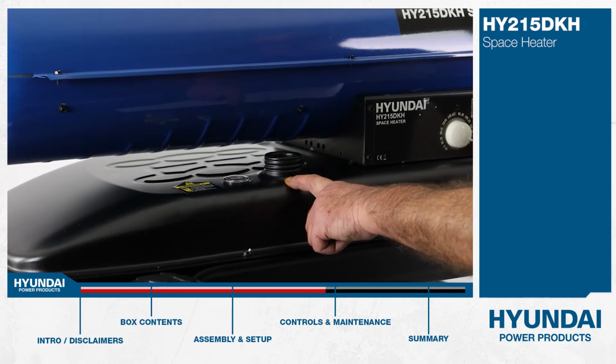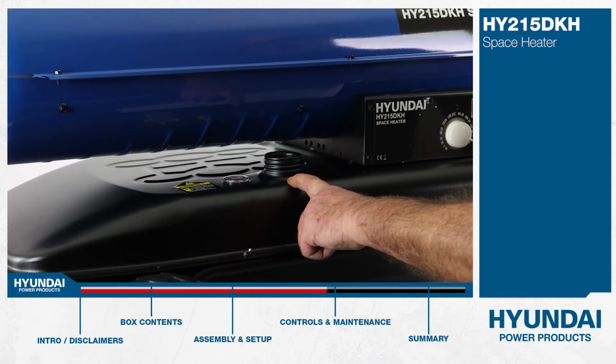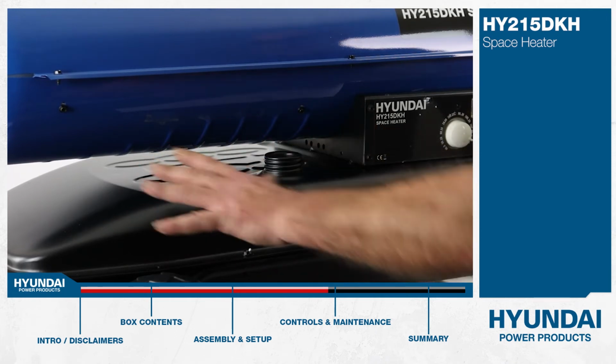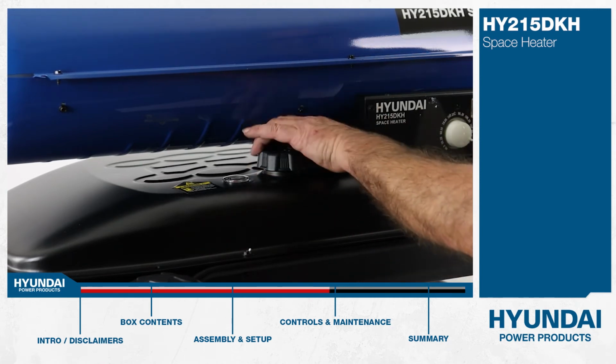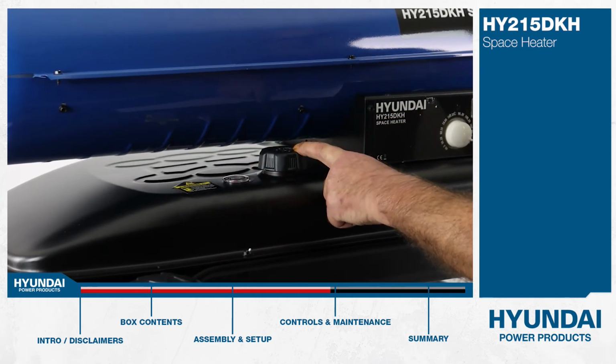So we would fill the fuel tank, not to the very rim here. We need to leave it perhaps an inch or so down. There's no point in overfilling it. If you do spill any fuel, make sure you clean it all up thoroughly. And again, we can replace the fuel filler cap, screw it down firmly by turning it clockwise.